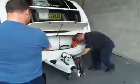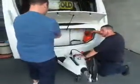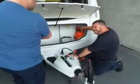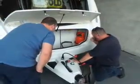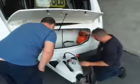Your gas cupboard in the front here. So you've got position for two bottles. This is your bottle, I've already fitted it in. They've given you a rather posh pigtail on here, so you don't need a spanner or anything, it's literally just cam type. It says open and close on there, all you literally do is just tighten it up by hand. No need for a spanner or anything. So that's already in and fitted.